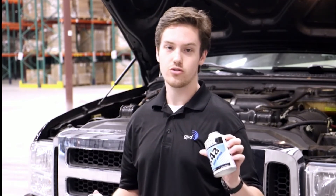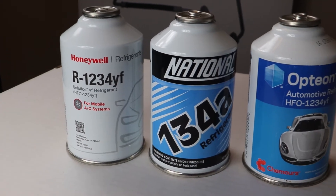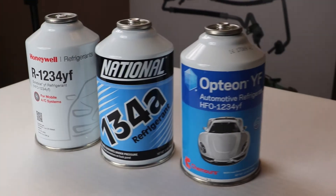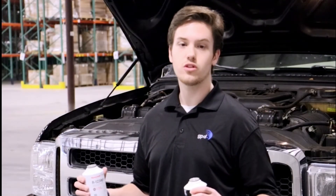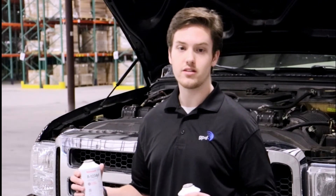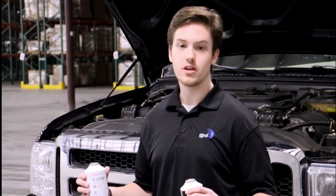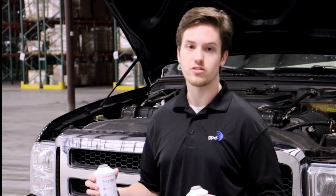Hey, I'm Andrew and today we're going to be talking about some refrigerant small can design changes. R134A is the most common refrigerant in the industry right now, but newer vehicles are starting to utilize R1234YF refrigerant. R1234YF cans have some different features than R134A cans, which includes the amount of refrigerant in the can, the type of threading on the cans and can taps, and some are self-sealing, meaning the excess refrigerant is kept in the can after a recharge process is complete.